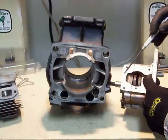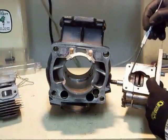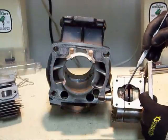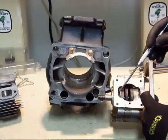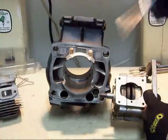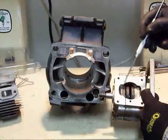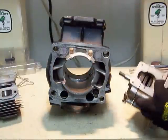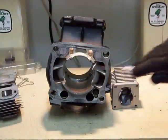I like to do some modifications on the crank side to these ramps and get those looking a little more efficient. You can see right there it's a crappy casting mark — that interferes. This angle right here is way too abrupt. These ramps correspond to the inlets on these transfers, and they all need to match. They all need to be contiguous — which means they need to match each other and flow nicely.